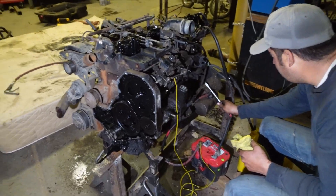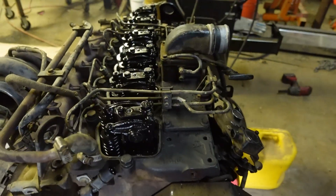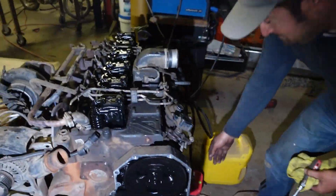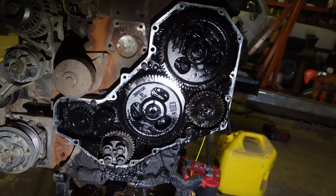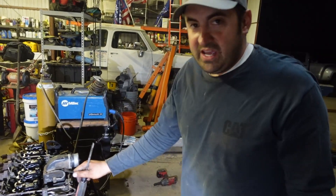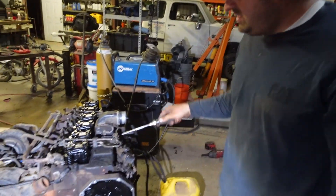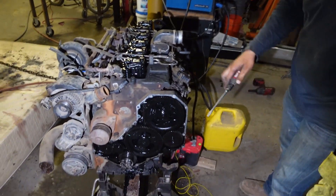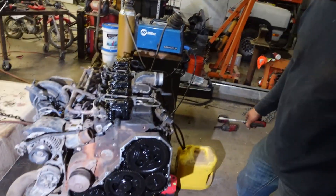It might make a little bit of a mess with some oil, we'll find out. See how fast it moves — it's a super slow-running motor. So that's how that works: this gear spins because it's connected to the crankshaft and then everything else moves. That's why these can be almost 100% mechanical. This one can't quite because it has the Bosch VE pump — these are for children. I'm going to get the P7100 pump but I'll need a new timing cover and new gears for that. It's a pretty simple conversion if the engine is already out of the truck.